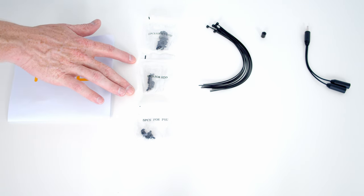We're going to do as much work on the motherboard as possible while it's on the table: installing the CPU, the cooler bracket, the M.2 SSD, and the RAM. To install the CPU, push the lever down, out, and up to open the socket cover. Set the CPU down into the socket lining up the notches, close the cover — the plastic protection pops off — then secure the lever.